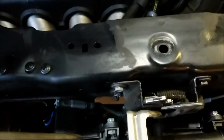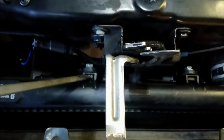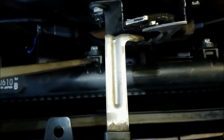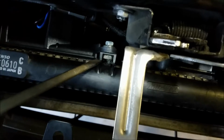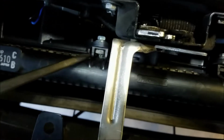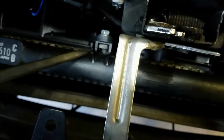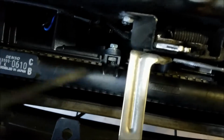So the one that I said the woman destroyed the radiator is because these nuts on the back were rusted. So I'd suggest you put a penetrating oil on there before you even try to break the bolts loose. And if they don't break fairly easily, try to get a pair of pliers on this little mounting flange here on each side. Try to get the jaws as parallel as possible, like water pump pliers or slip joint pliers or some other type that will hold both sides flat, and then try to break it loose and try real hard not to bust these plastic ears, well, the plastic sides of the mount, because it did, and when she did it, busted the top of the radiator, and this is plastic, so it's pretty easy to do.